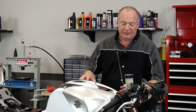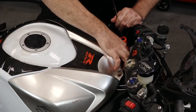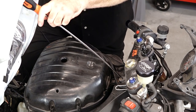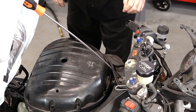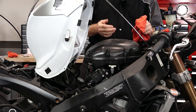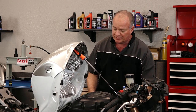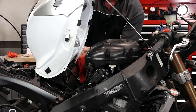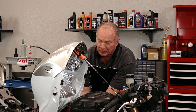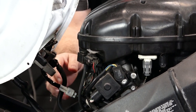As you can tell I've already been doing some work on this bike, so there isn't a whole lot that we have to disconnect like moving the seat or taking out the tank bolt. So we can just go straight in. First thing you want to do is disconnect your fuel lines. Now keep in mind if you've had it running recently or if it hasn't been sitting more than a day or so, there's probably pressure inside the line. So you want to have a cloth of some type in your hand — squeeze those little white or gray plastic ears together and then pull. This one didn't have any pressure in it so we're good to go.